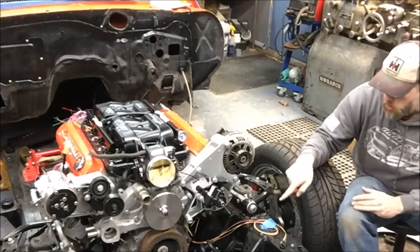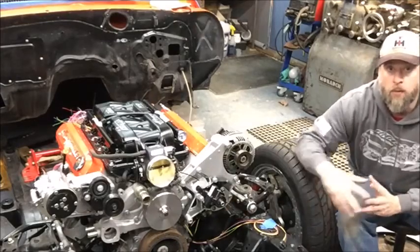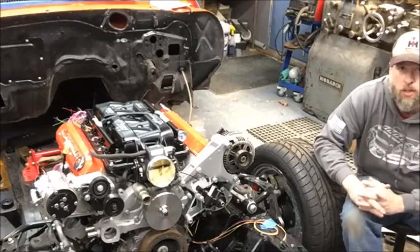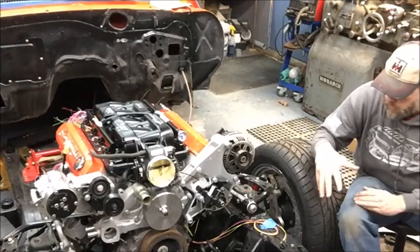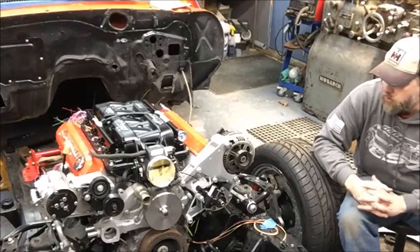You can see along the bottom the coil wires just don't shoot straight back between all the spark plug wires. They actually go around them, and the reason being is that if you run the coil wires through the spark plug wires you can get some electrical interference. By running it around the side and keeping the EFI wires separated from the spark plug wires you reduce the chances for interference in your ignition system.